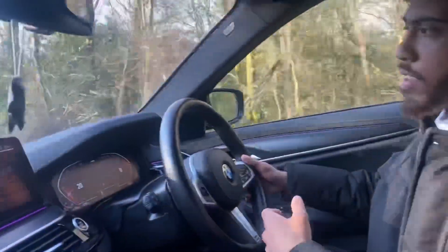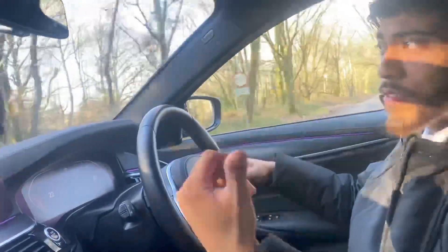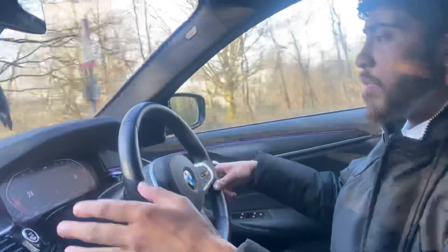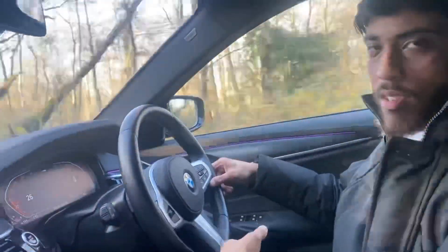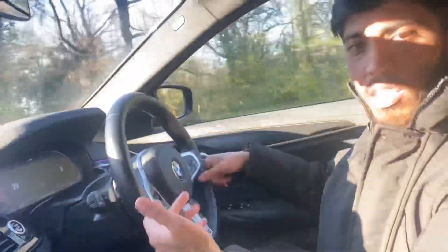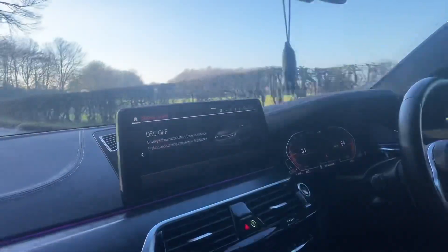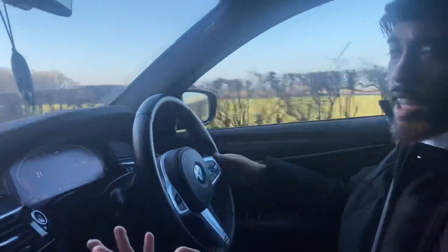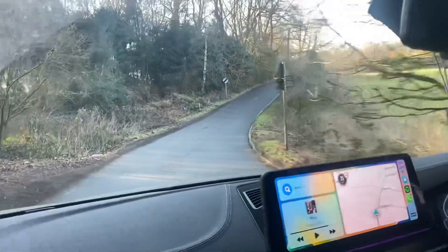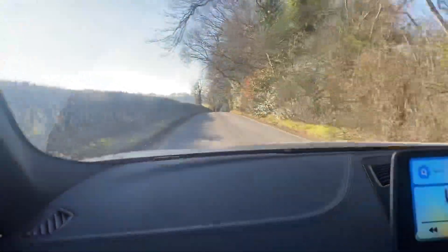Out on the road in Comfort mode with traction on, the car isn't jostling around despite having run-flat tyres, which typically make a car quite harsh. On the motorway you can just cruise along and easily get 45 miles per gallon; around town on diesel you'd realistically expect around 25 miles per gallon. On some longer swooping country bends to assess chassis control, flicking into Sport mode it holds traction only slightly — which I like. Unlike the Mercedes E-Class or Audi, BMW actually lets you manage traction yourself. Putting it in manual mode, the B57 lump is very responsive, pulling all the way to 5,000 rpm very easily.